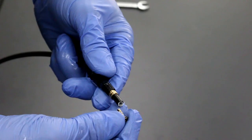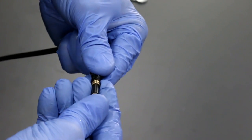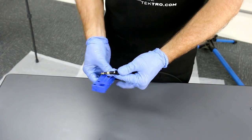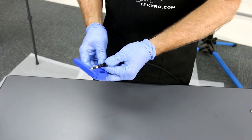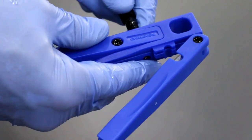Next, place the brass insert inside the hose and slide it in. To fully fit, press the brass insert in using the Tektro lever body — compress the insert all the way in.